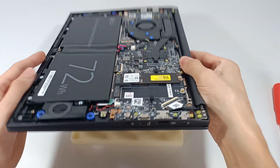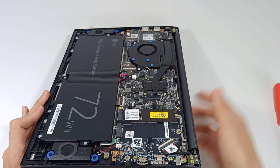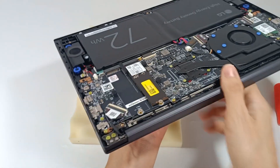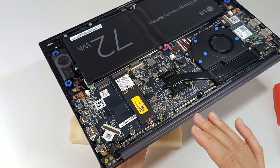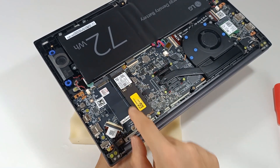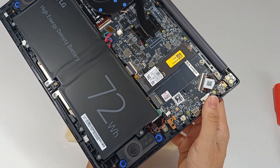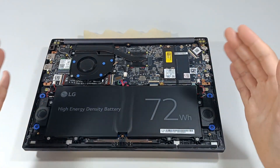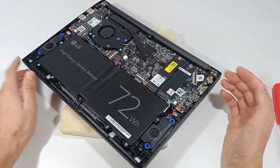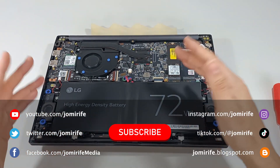Now, secured with a screw, the module is parallel to the computer's motherboard, so it is properly installed, and we can now place the cover back on the computer. Fitted this way, and with a screw in place, connecting the M.2 SSD in the computer is completely safe and correct, and this is what you need to do to replace or place an additional M.2 module. This computer has space for two M.2 modules, so I can place another M.2 module to expand the memory — and it's as easy as that to install an M.2 module on your computer. I hope this video helped you learn how an M.2 module is installed on a computer, either on a laptop or a desktop. Subscribe to the channel because I post new videos every week. Like the video, and if you have any questions, write in the comments.